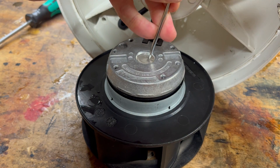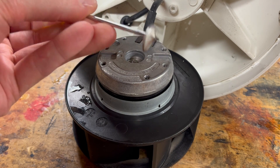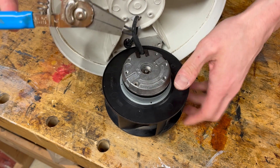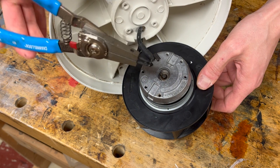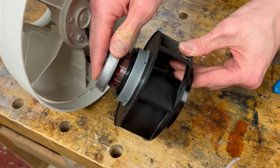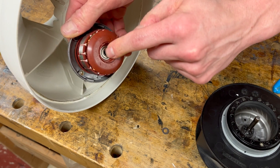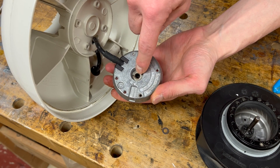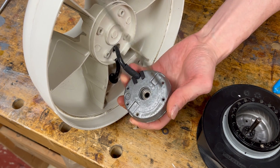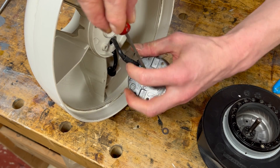You can just pound on the bearing cap with a screwdriver — this will destroy it, but you can replace it later. Next I'm going to use retaining ring pliers to remove the retaining ring. After that, the entire motor can come right out of the retainer. You'll notice a washer, and there are bearings on both ends that we're going to pull out. To get out this bearing I'm just going to take a small screwdriver and poke it through to hit the bearing and give it a slight tap.